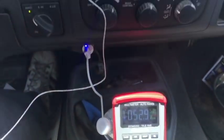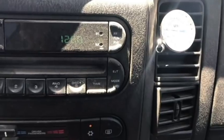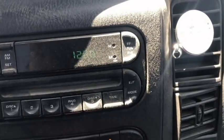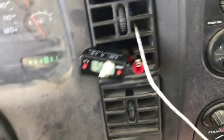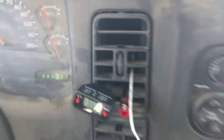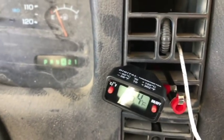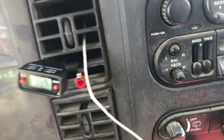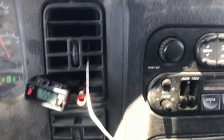As I depress the throttle, you can see the temperature starts to drop — the AC compressor clutch is moving faster. So which one's more accurate? The analog is quick and dirty but won't show you compressor cycling or the coldest point. The digital is a lot better than analog. The DVOM is the best because the probe is right in that vent getting all that airflow. Also, sleeve versus no-sleeve — I didn't see a huge difference, so I wouldn't worry about it too much.